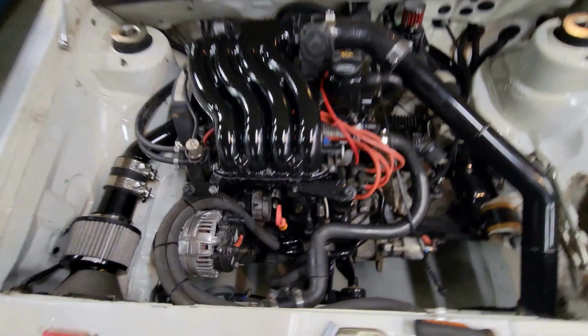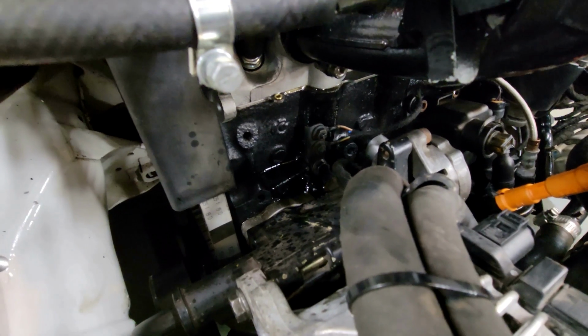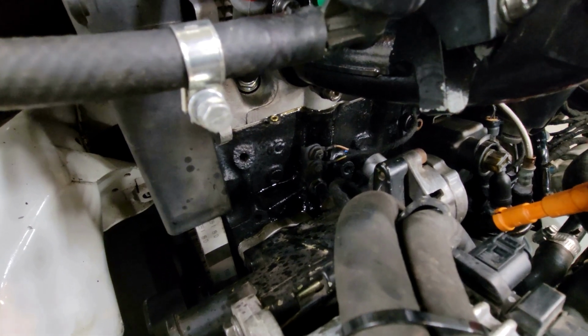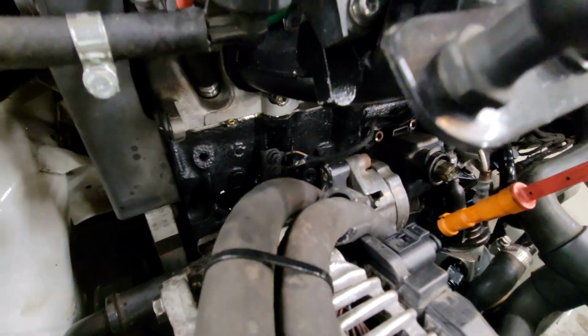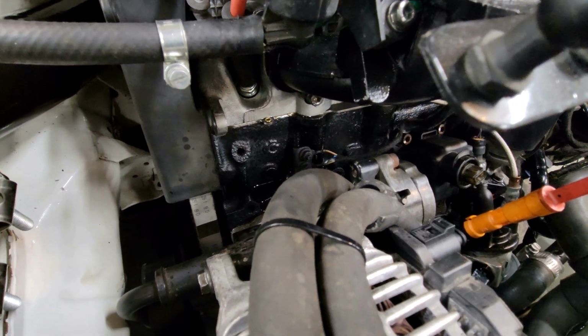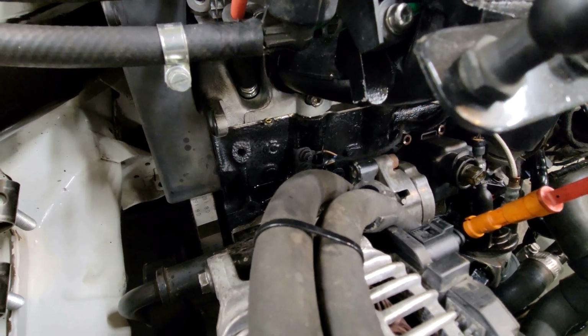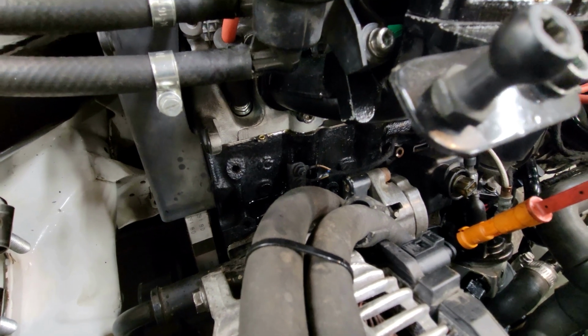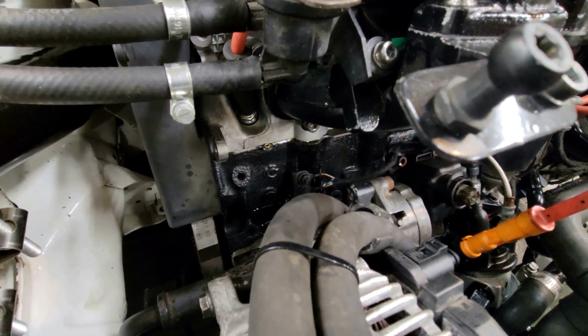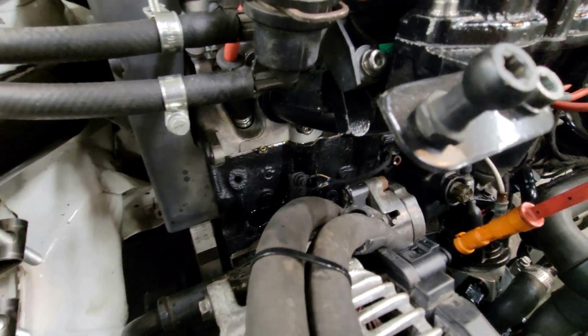Went to fire it up, build oil pressure, and the catalog had the wrong head gasket for this engine. So I ended up getting the incorrect Cometic head gasket, and that's a problem. So I called them. They've been cool. I'm hoping they can build the correct thickness that I need and send me a new one ASAP. So just a FYI, if you go to buy a Cometic head gasket off of like Summit or whatever, they have them cataloged wrong.